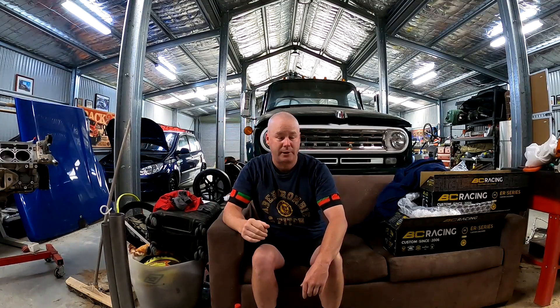Magnuson, their Heartbeat series — we'll show pictures as we're talking here. They're another very popular blower, probably more popular in the US than here in Australia, but there's a number of seriously capable cars getting around here with that Magnuson blower. They look amazing as well — they've got quite an interesting intercooler design, and all these fit underneath the bonnet and maintain pretty much an OEM look to your car, really, until someone gets to hear the whine. The big blowers in Australia are by Whipple, and they're starting to get up in the 2.9, 3.4 litre territory. They're a great blower but typically you can't hide them under your bonnet — you've got to have a hole in your bonnet. The one we see the most of is probably the Harrop, because a lot of the Walkinshaw Harrop dealers use it as the mainstream blower.